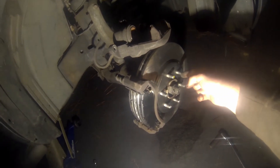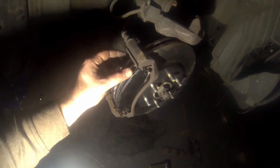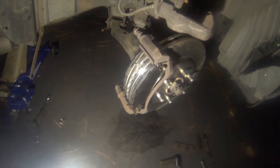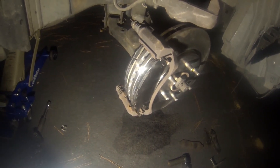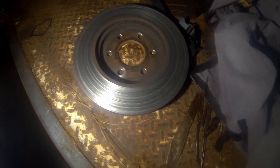Also remember these little holes right here — I believe this car has a little spring here to keep these from touching. However, when I took this apart they were not there, and my new set of pads did not come with them, so I'm not installing them with springs right now. But if your car has them, you should reuse them. That pad looked pretty nasty, and the rotor — the pad was eaten to the end of that pretty good. Thanks for watching.